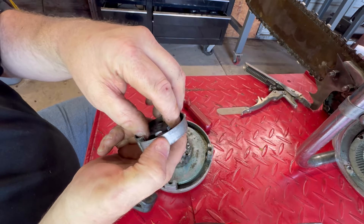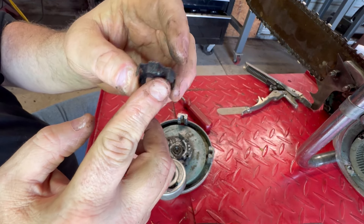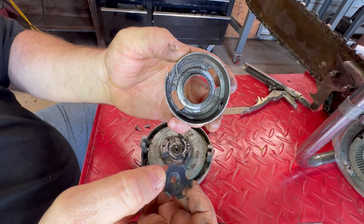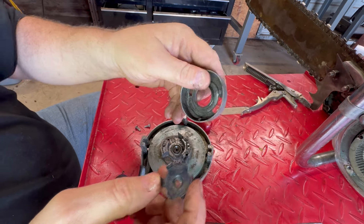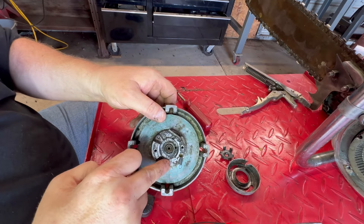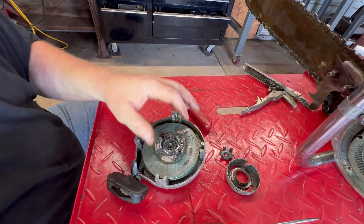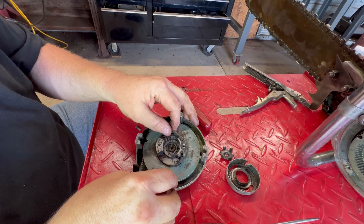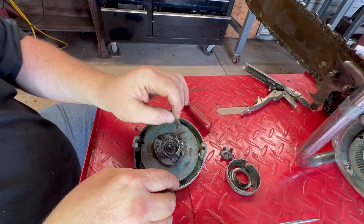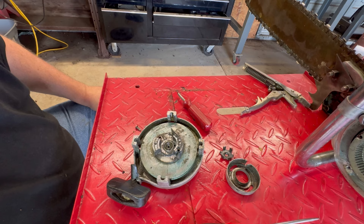What we're going to have to do is take a pair of pliers and tweak these little fingers — bend them in just a little bit so they'll grab onto the pawl retainer. I bet we'll have this thing fixed up and ready to go. First thing, though, I'm going to get this all cleaned up, get all this grease off of here, all this grime, and make sure the spring isn't messed up. Now this one just has one pawl, as you can tell — it kind of looks like a Briggs and Stratton.